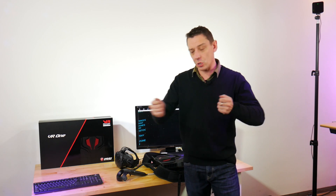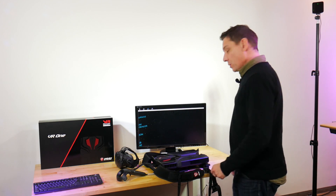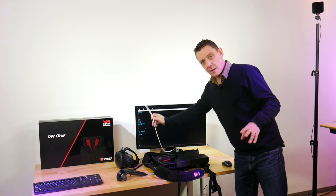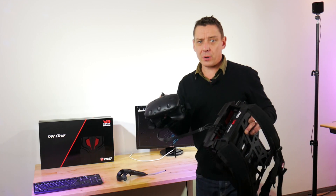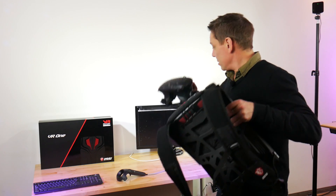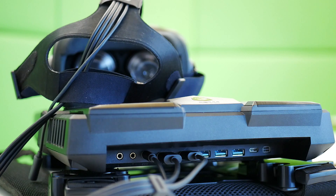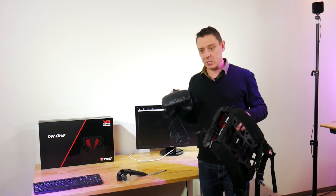There's a desktop scenario that you can use with the controllers, but it's not that easy. On first setup, you probably want to be using it in a desktop mode with a screen. What we've done here is used a DisplayLink adapter. The DisplayPort is not connected, which gives us the ability to run a separate video channel into an HDMI device — in this case a monitor. Later on I'll be putting it into a capture card to capture some of the content. You need to work out first how you're going to do your wireless display so you can manage the system while it's in use.